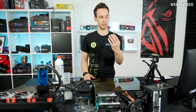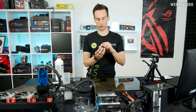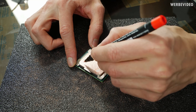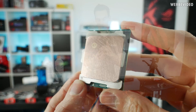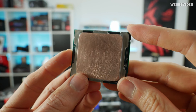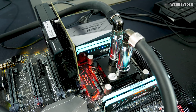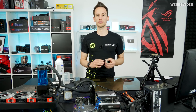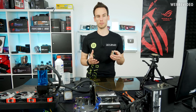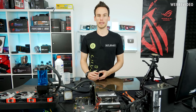After almost 40 minutes, I'm back with this CPU and it took much longer than I actually expected. After about 10 minutes almost all of the nickel surface was gone, but only in the four corners could I still see some nickel remaining, and removing that took almost another half an hour. The surface is really extremely rough now — if I move across with my fingernail I can really feel how deep those scratches are. We're going to test it now. The test setup is a Rampage 6 Apex, 32 GB Crucial Ballistix memory, and 360 custom water cooling from EK. The CPU, as I said, is not delidded — it's a 7920X, overclocked to 4.4 GHz at 1.25V. Testing with Prime95 non-AVX, 12K FFT — very small FFT size for high power consumption — at 15 minutes. After the 15 minutes we will be back and take a look at the results.